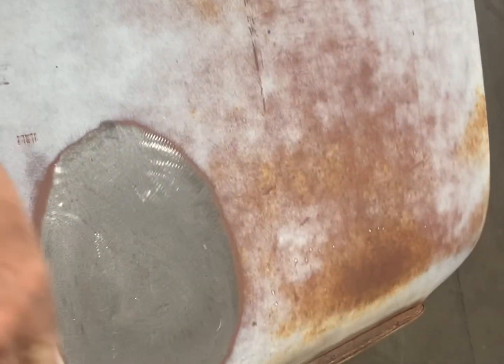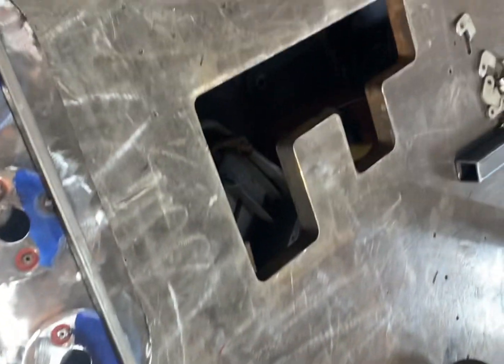Then we'll lay it up here, get our measurements that we recorded down, scribe with a scribe, trim this roof out, try to start setting them in and tacking them in, and this here keeps them the right distance apart. It just takes out some measuring and whatnot, by tacking this across here, keeps everything orientated the right way. Stay tuned, let's go.